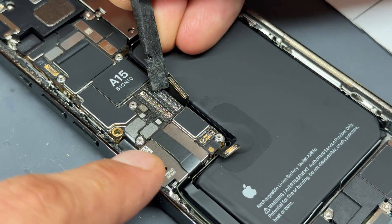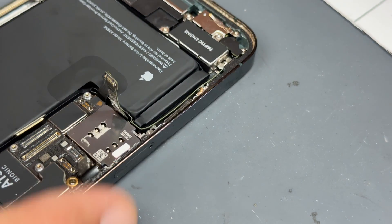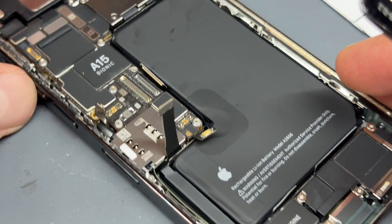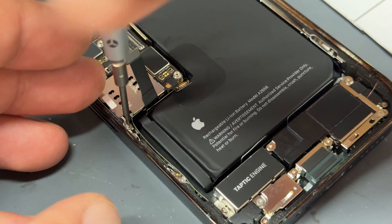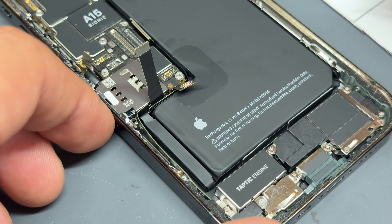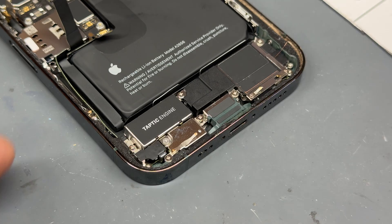There's a standoff screw that needs to be removed here, then we've got the charging port cable and two other connectors just down here — just peel that back. Next we've got the SIM tray that needs to be removed. I try to keep it very systematic working from top to bottom, and then when we get to the bottom area working from left to right. Continuing down this edge there are two more tri-wing screws holding the antenna or coaxial cable in place — remove those and there's a little grounding clip on that one as well, which is attached so it's fine.